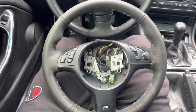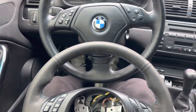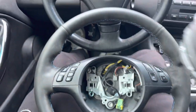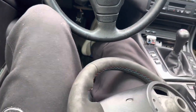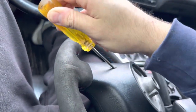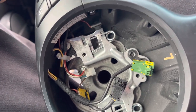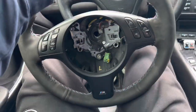First step in installing this: you guys are gonna need a flathead of some type. My wheel came with this — I already put in the airbag, the horn, whatnot. You are gonna want to take a screwdriver and pretty much put it through here. You're just gonna want to push that bar forward like such. This is the angle you're gonna want to go at — I was having to work at it for a bit before I got the springs actually disconnected.